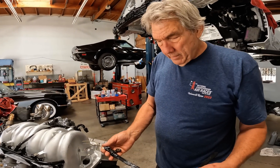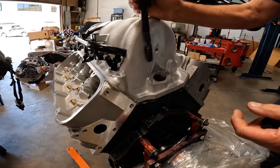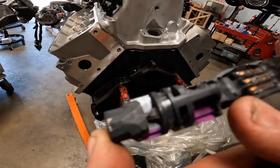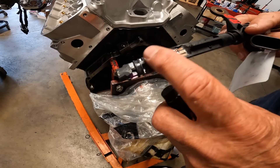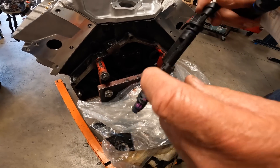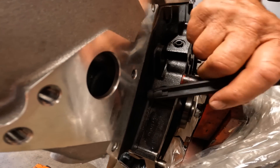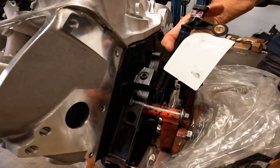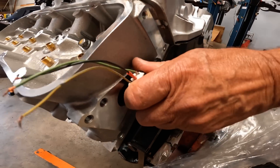Okay, this is one of the other adventures we had. The crankshaft sensor from an 8.1 doesn't work with the computer. So this sensor here goes in there — and this is where the sensor mounts for an 8.1, way different than an LS. What we did is this half here is an LS sensor. We cut the bottom half of the 8.1 housing off, took the LS sensor, put it in there, turned it down, and now the LS sensor is getting epoxied onto this piece — and then it drops in there. One thing that's really interesting: the LS sensor's got a big magnet in the end — you can see it sticking. But this 8.1 sensor — you've got nothing. So that's why it was working with one and not the other. Whatever they do with this sensor, it's not the same kind of sensor. So we made this one using the LS sensor in it — that plugs in there.